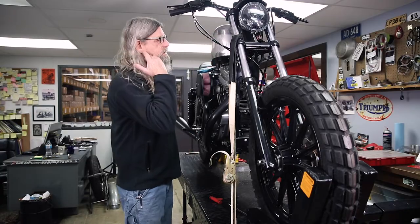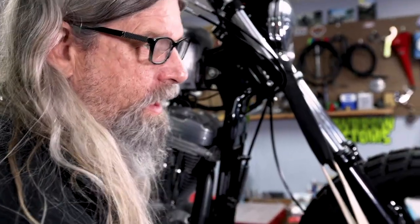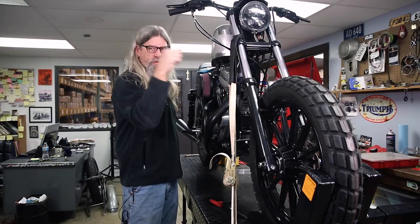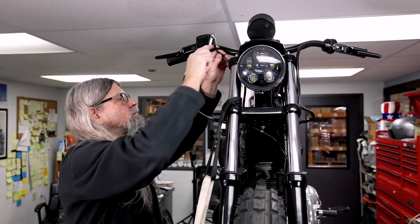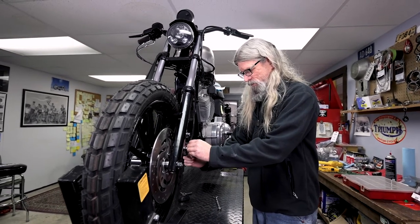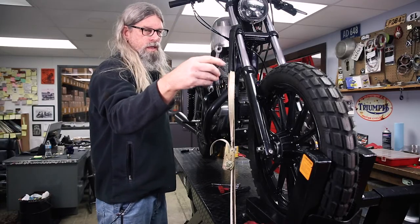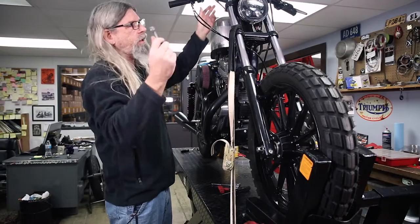What you can do to take up extra room is take a piece of hose, cut a piece about this long, slice down the middle, and slip it over the brake line, then put it in the clamp if you want it completely secured. You may notice I used a special line wrench — it's got a six-point with a slot on it, which is a good plan for these fittings so you don't slip off and mark them up.